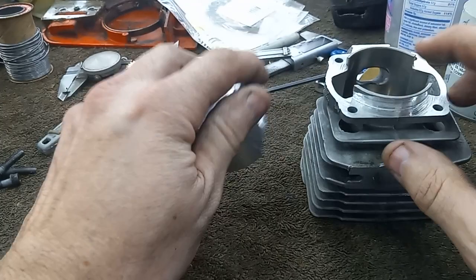Here's a China cylinder. You can see how much difference the combustion chamber is. And with that pop-up, I'm hoping to get some good compression out of this thing. I checked the stroke on it — I believe it's a 32mm stroke. You can see how much I cut off that base. I'm right to the numbers now.